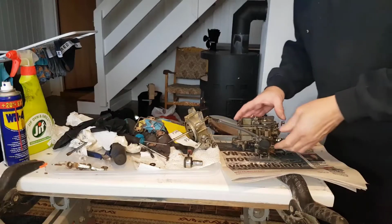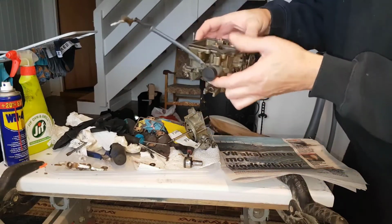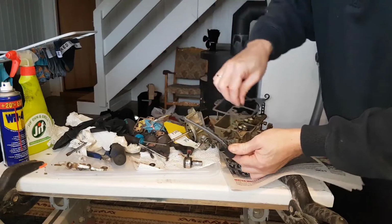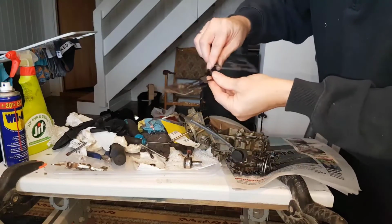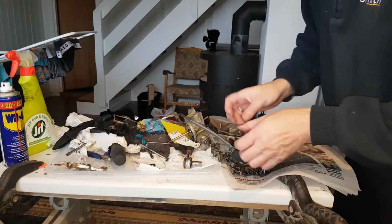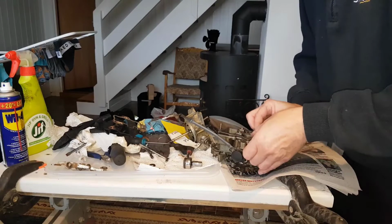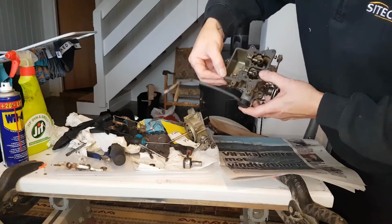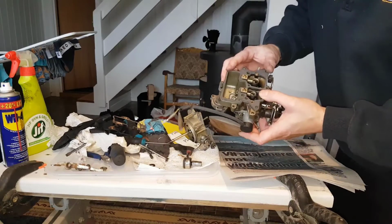Okay, so I have gone and cut out a thicker gasket, 1.5 millimeter, which is pretty much the same as the one that used to be there. So now I will start to assemble the whole thing, and hopefully this will be perfect. I made a few minor adjustments, so it is now better on this side. Still it could have been maybe 0.5 mil further out, but okay, I think it's a nice fit now.